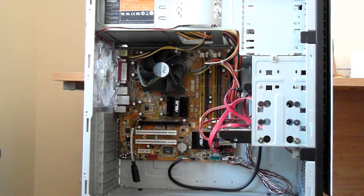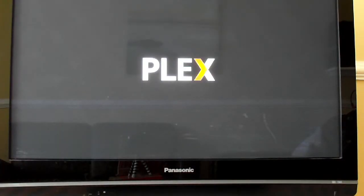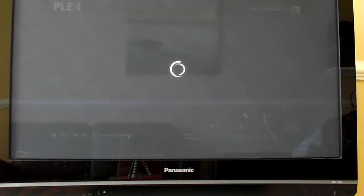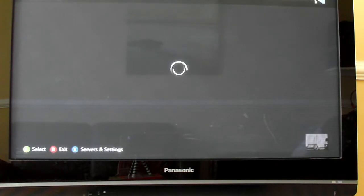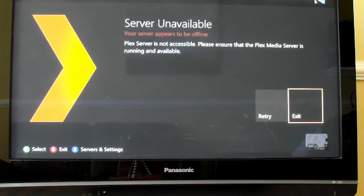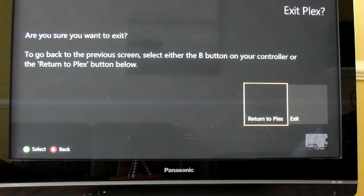However, after about 2 to 3 months of usage of the machine, and this was not the machine being on full time, by the way, I came to use the machine one day and it just didn't work. It didn't boot at all. So I looked into the machine. I decided that the issue was that the boot drive wasn't being recognised and the USB memory stick had died.